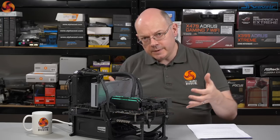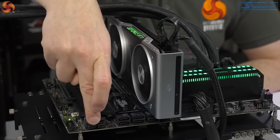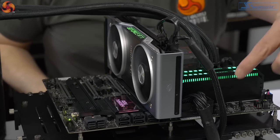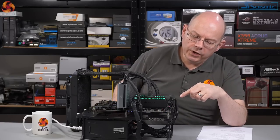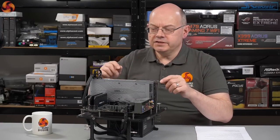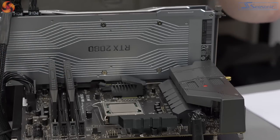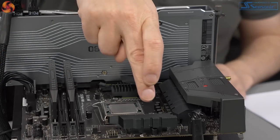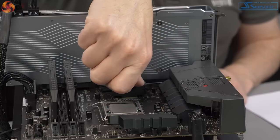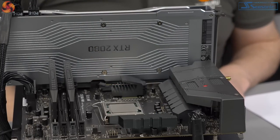Underneath the board, most of the RGB actually seems to be under the board. There are six SATA ports laid down and two U.2. Over here we have the main power connector. Around the head of the board we have one 8-pin EPS. With the power turned off the RGB obviously goes, including on the Corsair Dominator Platinum RGB which has really bright LEDs. We can see some really chunky aluminium heatsinks on the VRMs, and also a chunky aluminium heatsink on the PLX chip above the main graphics slot.